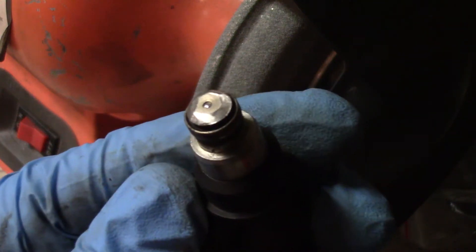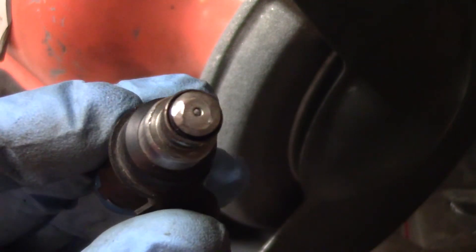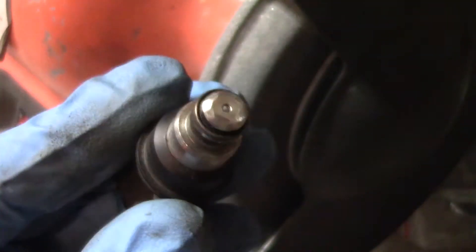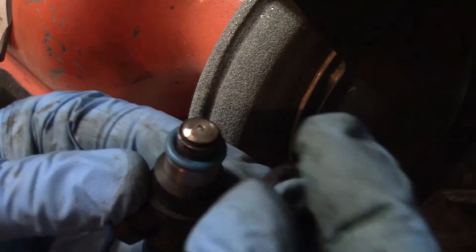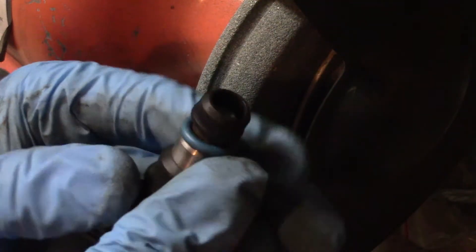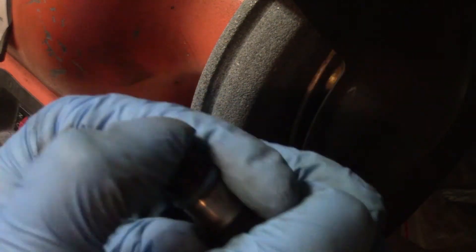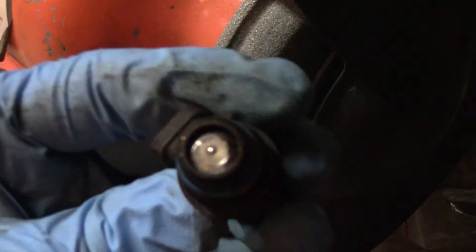There is your decapped injector. This one is all set. All you have to do — first put the o-ring back on, and then your cap. Sometimes it will snap on by hand; if not, get it centered on there and then just tap the face of it against the work bench one good time, and this one is ready to go.